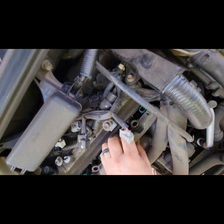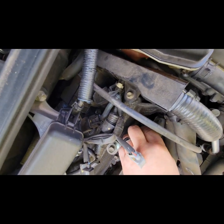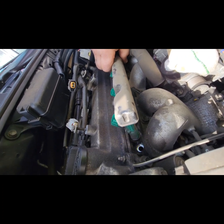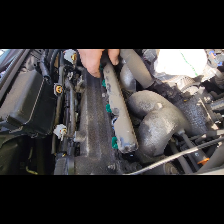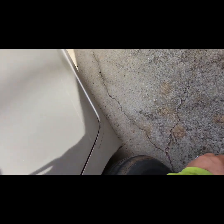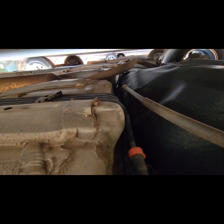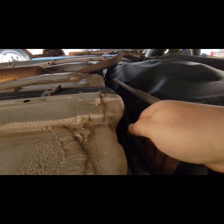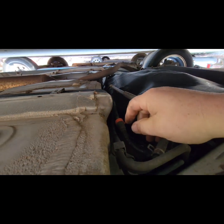This just comes up and comes right out. When you unplug these injectors, the fuel rail is under pressure and there's no place to relieve the pressure. So you can go under the car — under there there's a red clip right in front of the gas tank. You can take this off and squeeze that fuel line and all the gas pressure will come off.